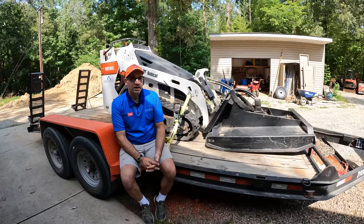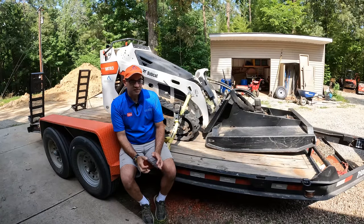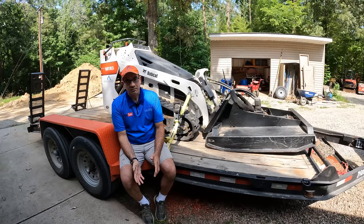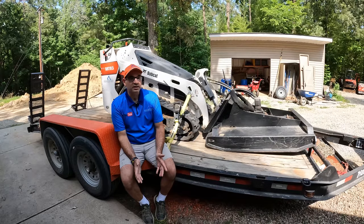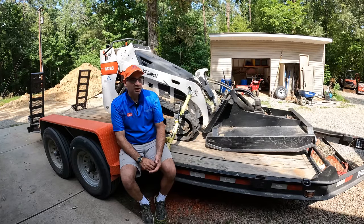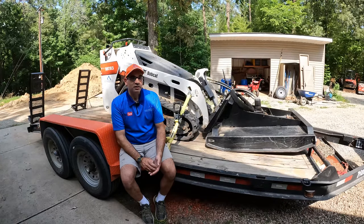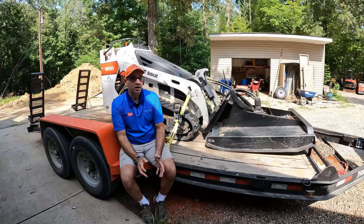What I didn't realize about it is that the deck height was so high. And the fact that it had the 6,000 pound axles meant that changing over to a 4-inch drop with 8-lug 7,000 pound axles was an okay deal. I was able to sell the old axles and wheels and hardware and fenders for right at half of what I paid for the new stuff. So that washed out pretty well.